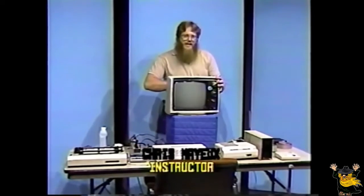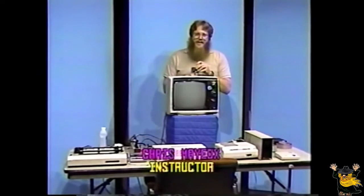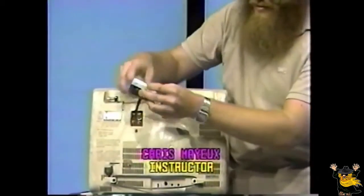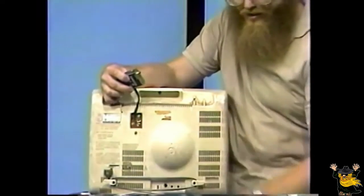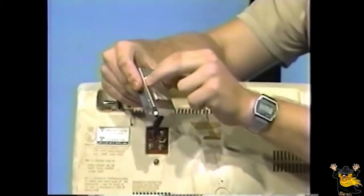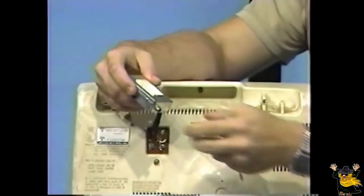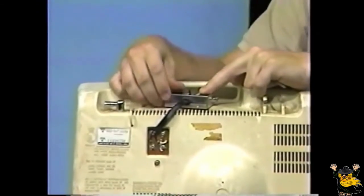First, locate the antenna switch box. Notice the ribbon-type connector on the cable that is attached to it. Connect it to the VHF antenna leads on the back of the television using a small flathead screwdriver or some other similar device. Next, remove the paper backing from the adhesive strip on the back of the switch box and stick it to the television in a place convenient but yet not in the way.